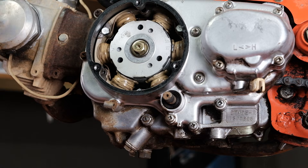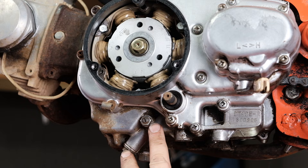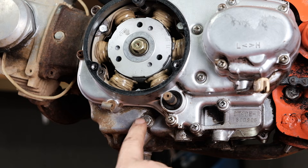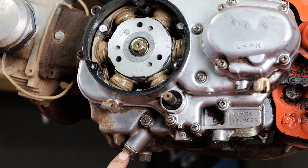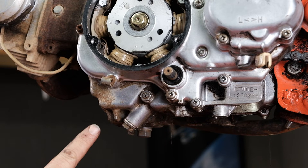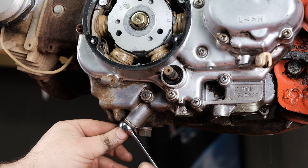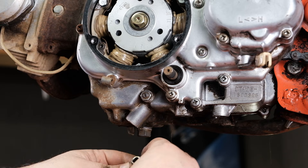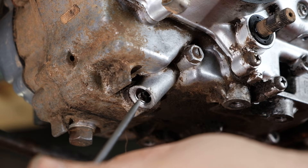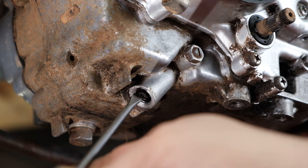We lifted the bike a bit further and removed the crash guard and foot pegs so you can see what's happening in here a little bit better. This is our cam chain adjustment system on the bikes that have the mechanical setup — if it's hydraulic, you're not going to have this. We have a lock screw and a jam nut that puts pressure on the piston to lock it in place. Then we have a cap and there's another screw under there that puts pressure on the spring to push a piston up. It's like a little cylinder — a piston that puts tension on the tensioner. And there's a flathead screw that screws inward to put pressure on the spring and then on the piston.